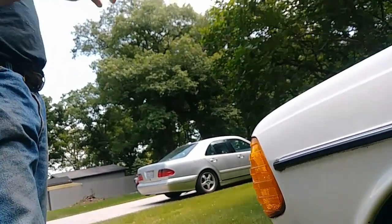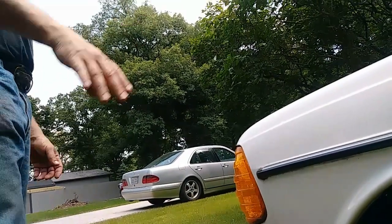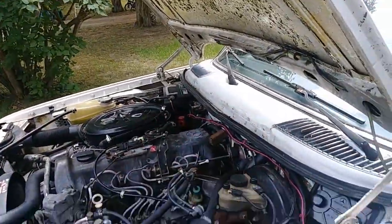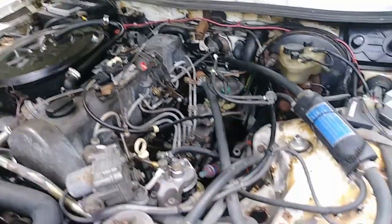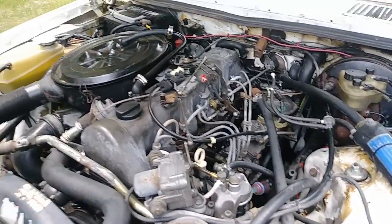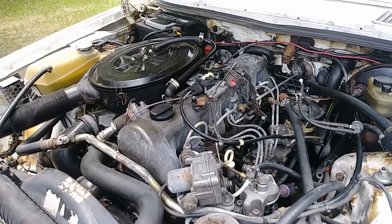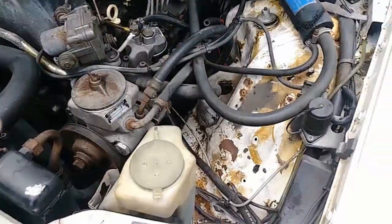Then I could use the factory clip that holds tension from the steel line. I bled it farthest from the source first — closed this bleeder, closed this one, filled it up, then hooked up my vacuum pump with the reservoir and a line to the bleeder. I pumped it up to about 20 inches, then opened the bleeder. Did that seven or eight times on this side.